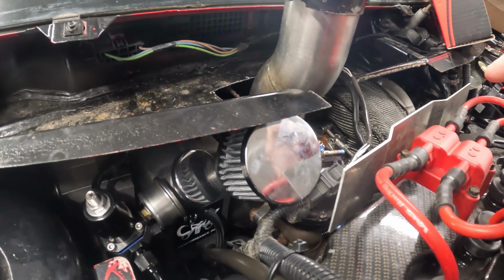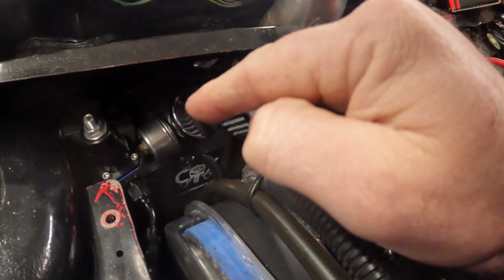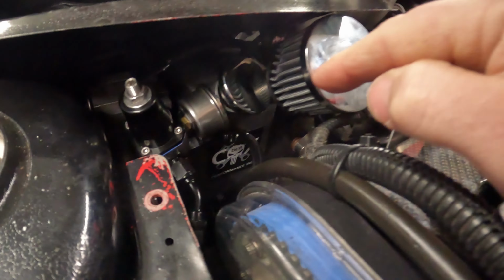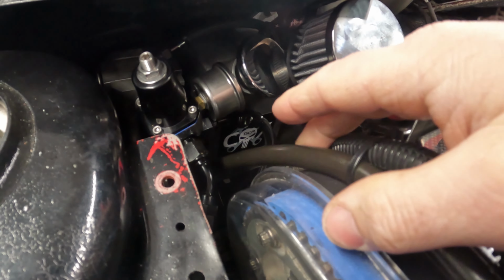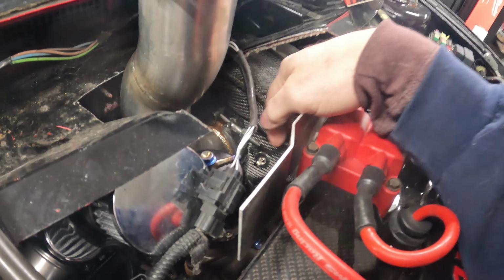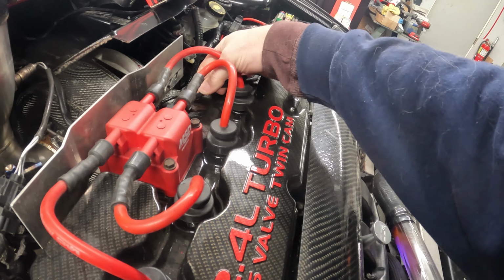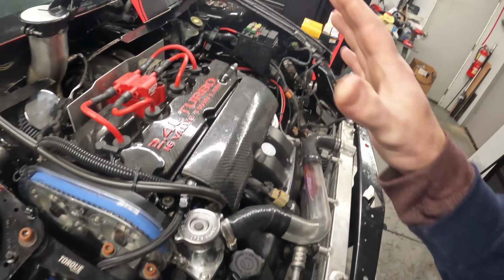So we're going to get this out of here. We've got to get our fuel line fixed up and run some way where it's not touching everything. Like everything's just a mess. This wiring here is really close to this exhaust. It can melt. We have the AFR gauge. Not sure what was happening here, but they have that zip tied right here.